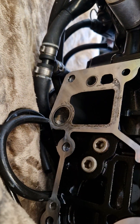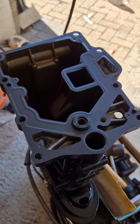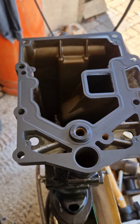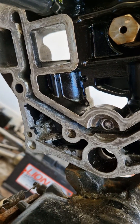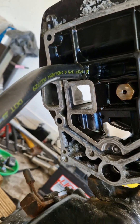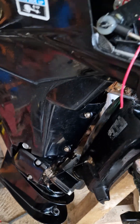Here we are now — the new gaskets in place, everything cleaned up and ready to go back together. You can see I've lined it up perfectly over the port and it's a proper match for the original layout. After cleaning all the mating surfaces and making sure the waterways are clear, this gasket's going to give us a proper seal. I've gone over the block face and the head to make sure there's no warping or leftover corrosion that could cause a leak down the line. Everything's ready to bolt down tight and get this head back on.